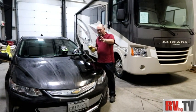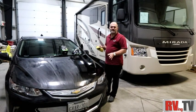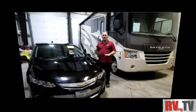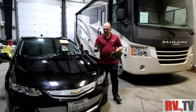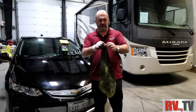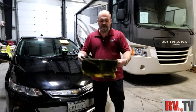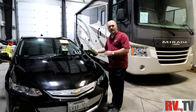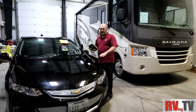This pre-cleaner is tinted as well, so as you're putting it on and helping to take light contaminants off, it's already starting to fill in some of those fine scratches. Already we're starting to see that glossy shine coming off the car. We've now buffed off all the pre-wax cleaner — and this is why you want to have a glove. As you buff it off and flip to a clean side for a finishing buff, you should already be seeing much more gloss and a much cleaner-looking car.